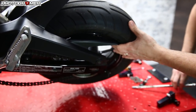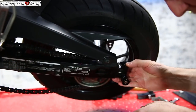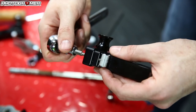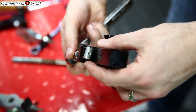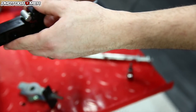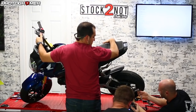We're just going to take this guy out and put the new one in. You're going to want to make sure the top one is all the way loose so the NDC adjuster slides in. Boom — slides all the way in. We'll tighten the top Allen hex bolt, then lean the bike back up, get the spacer back in, and wiggle the axle until it finds its hole.